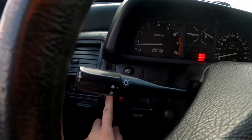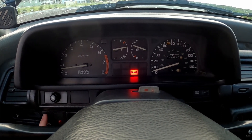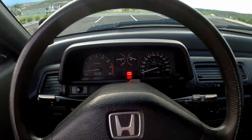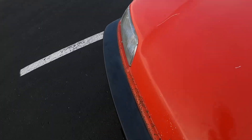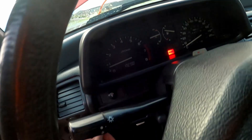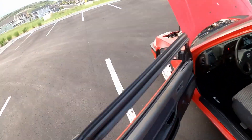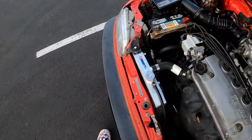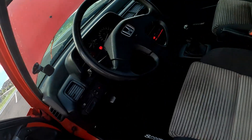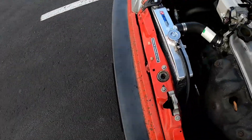One thing that's quite peculiar — I'm going to hit the sunroof switch here. You see that? And now we're overheating, quote unquote. I don't think I believe that for a second. Let's go investigate. I don't even think the thermostat's open yet, the fan's not on, it's warm — but we're sitting over hot right now. What the fuck is that? You see how much higher it goes? This is a really weird issue, I'm not sure what's going on. It's definitely not hot enough — it's probably pretty close to turning the fan on. If I press this, it goes up like that. There's the fan — fan turns on, kind of as expected.